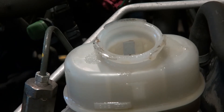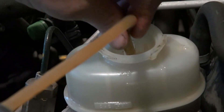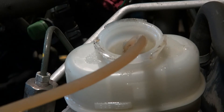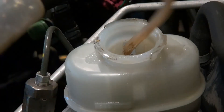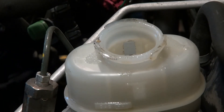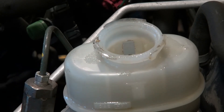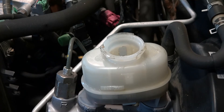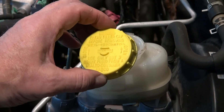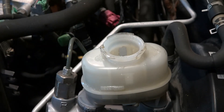I'm going to try once more to see if I can get any more out through the side. I think I've pretty much got it all. Now I can add the brake fluid. On the cap it's a little hard to read, but it does say DOT 3 brake fluid, so I've got a can of that.